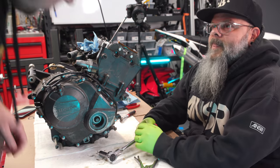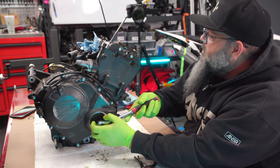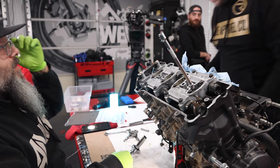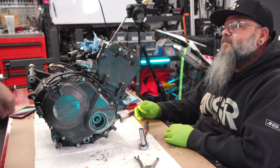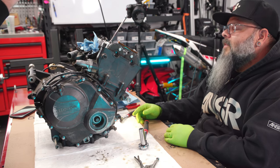And you just were able to tell that off the top of it. Okay. So it's a little off. I can turn it a couple of degrees and it's not gonna move the piston anywhere. And now that's perfectly at the T mark. Right. That's a pretty cool way of doing it too. It's very physical. You get to watch it go up, kind of chill, and then come back down.